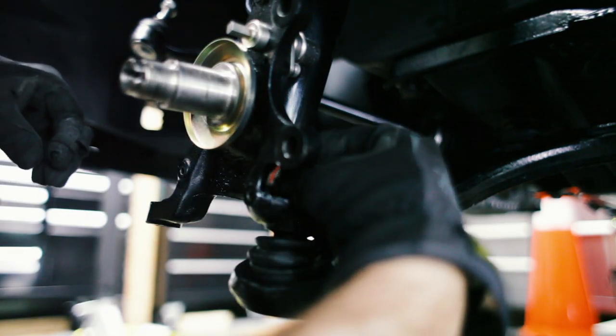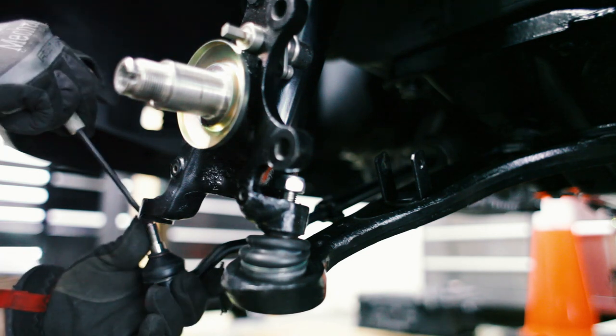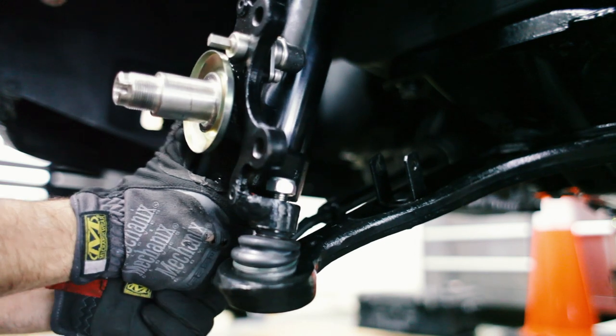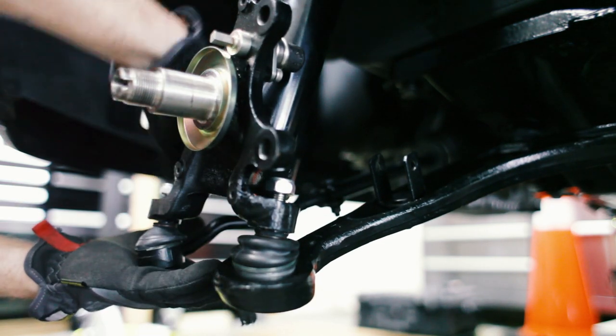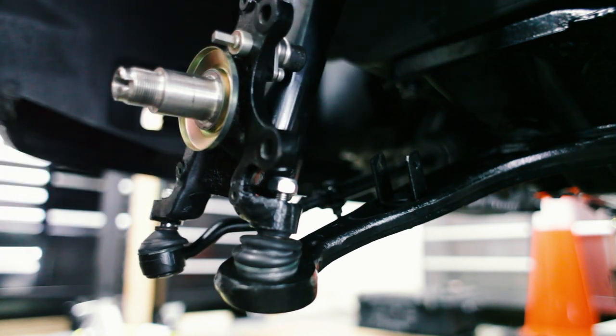I'm going to loosely put the nut on, connect the steering link, put that on, and we should be in good shape. Now I'm going to tighten the nuts at the top at the strut tower, then go ahead and put on the sway bar, then the control arm bushings or lollipops, torque everything down, and then we'll put bearings on this sucker. We're close — let's get to it.